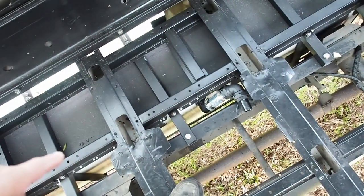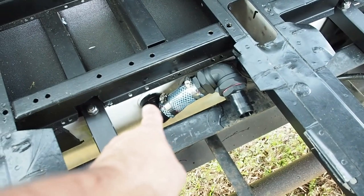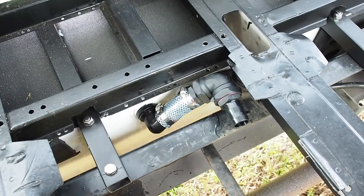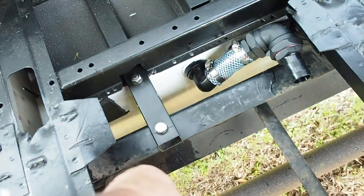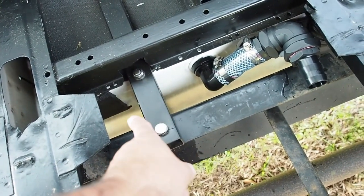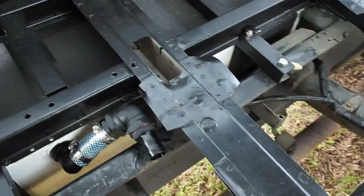The bigger the hose size, the harder it is to maneuver and get onto the barbs. So if you have a look here, this one here was a really difficult one to do. It's a 32 mil, one and one quarter inch connection, and I did plan to go this way and then back up this way. Unfortunately, there was no hand space or anything to get it onto the end of the barb of the connection. So then I've had to do it this way and come up this way, and I'm going to put another elbow and we'll go up towards the back where we'll fill from.